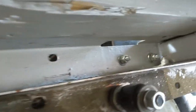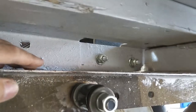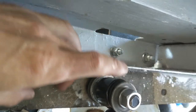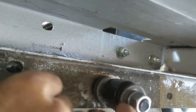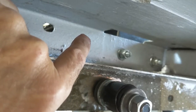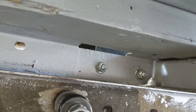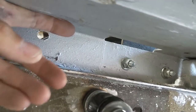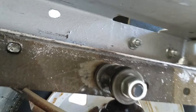Using two-inch stock should give me roughly two inches more travel upward. I can't go any higher because then the top of the shock would hit the wood, since it sticks down a little beyond the frame box. So I'm modifying the work — small job, just cut that off and build the new piece. I'll probably put a couple of self-tappers in it coming from outside in, just to hold it in place. Once it's bolted down it won't go far anyway.